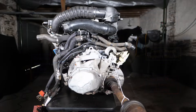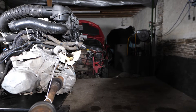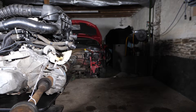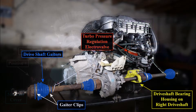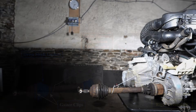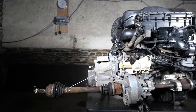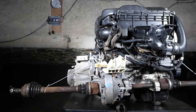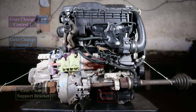The oil pump is driven by a chain from the crankshaft — worth noting that the crankshaft sprocket isn't keyed to the crank and is a friction fit only. Some issues have come to light with this engine — the main one being the quoted time between oil services being too long, which can cause burnt oil deposits around the engine, accelerating wear on almost all items. Changing the oil every 6,000 miles is advised, using a top quality oil such as Total Quartz Energy 9000, which is a 0W30 oil.